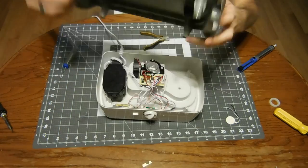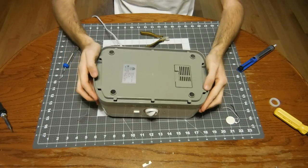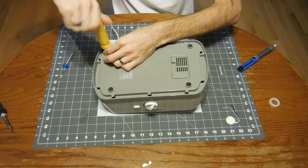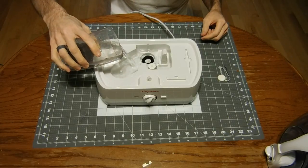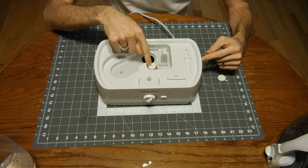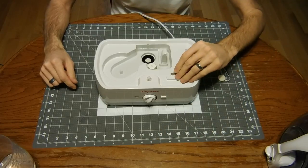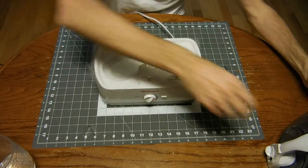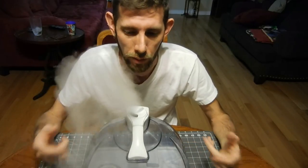Let's go ahead and put this bottom back on. Alright, moment of truth. While I had the bottom off I did notice there's a little float right here and there is a switch on that float — so if you don't have enough water, it's not going to turn on. Get my little magnet — there we go! You can see it's making mist, throwing stuff all over the place. Like I said, these things don't cost that much, but for six bucks you can repair something, keep it out of the landfill, and have a good working unit again.